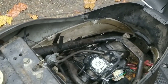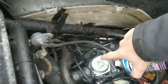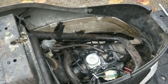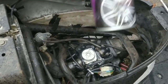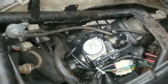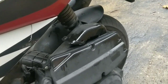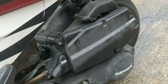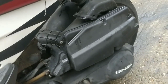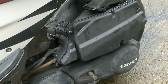Let's start with the spray test. My main two concern areas are here and here - if the bike revs up, there's a gap; if the bike dies, there may also be a gap. I'm using brake cleaner. No change there. Engine went a bit lower there spraying along here. It all died down a touch. My next job is to take the air filter out and see if it runs better without it - it might be starving itself of air. With the air filter out, it's not air starvation related.